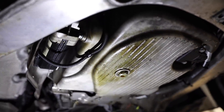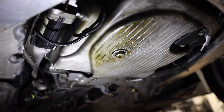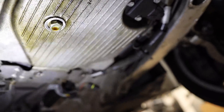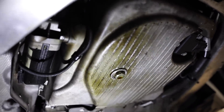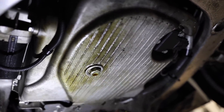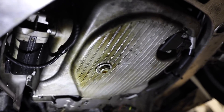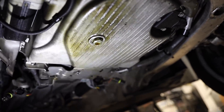I got all that protective shielding and everything off. Sorry about the light — I got a new camera and the light and the camera frame rates are not playing well together. One interesting thing is I've looked all around the oil pan here, around that drain bolt, and the oil really isn't coming from any other location and pooling down there. It really seems like it's actually coming from the drain bolt, which I think is a good thing. I'll replace the crush washer, make sure the bolt isn't fouled anywhere, and we should actually be in a pretty good spot. Hopefully that's the solution to the oil leak. So the next step is we're going to go ahead and drain the oil with a magnet in the drain line. I'm basically going to pop the oil drain right here, hold a magnet so the oil is dripping right over the magnet, and then we'll go ahead and inspect the magnet when it's done.